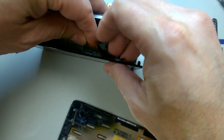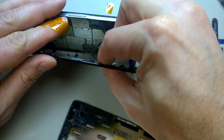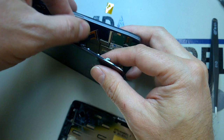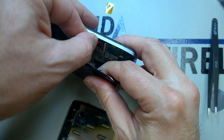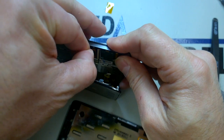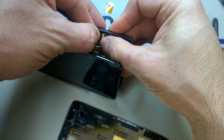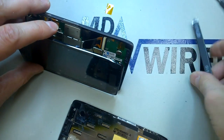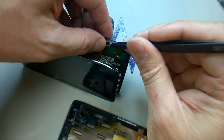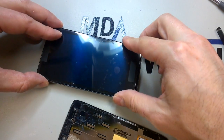And it looks like this one actually had a bit of adhesive behind it, so I'm going to go ahead and remove that and stick that down against that metal plate. And this will probably be the funnest part of all, and that is to get this thing tucked into the FFC connector. And of course, make sure that that's still open before you do. And then it'll just take a little bit of manipulation in order to get that thing plugged in all the way. And as soon as you do that, you want to flip the gate down, get the tape back on, and don't pull against it, because if you do, it will kind of go sideways on you on the inside. Those things aren't really sturdy as far as holding them in place.